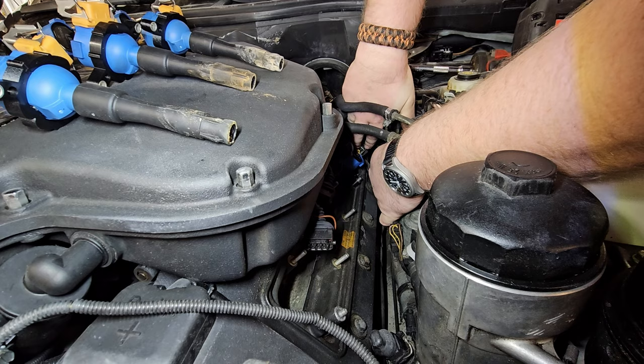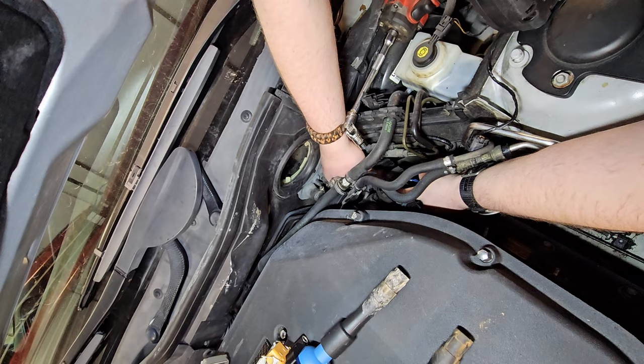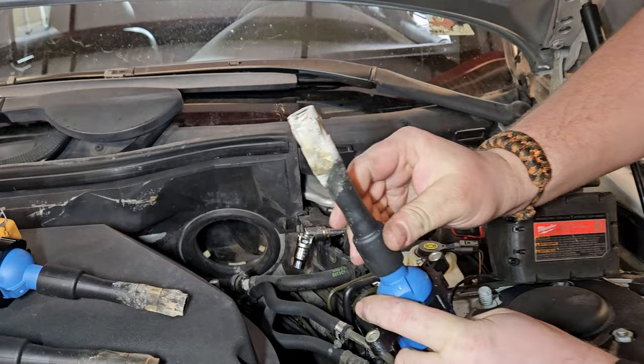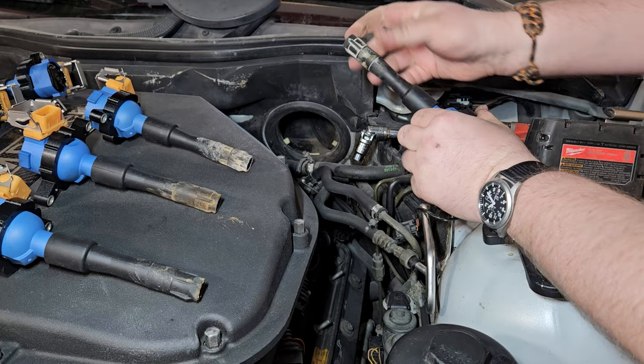Let's move this out of the way and get this last guy out of here. I got the nuts off already. You can see where the fuel lines and even this brake vacuum line is kind of a problem. This one doesn't want to give up the goods — the back corner, the finicky one. That's actually aluminum corrosion deposits — it's had condensation in it. Could you put grease on the end of the boot to keep that from happening? I have put grease and actually Dinan put grease in here too. There has been grease in the boot.